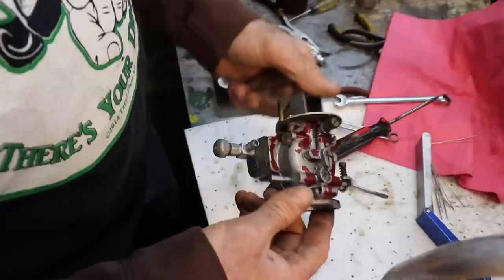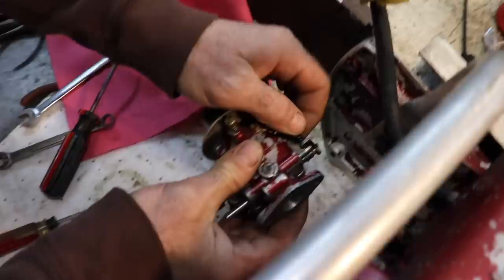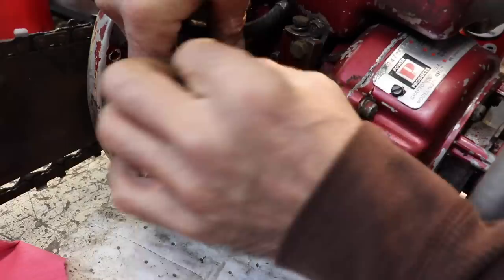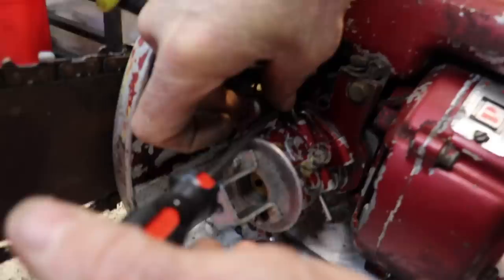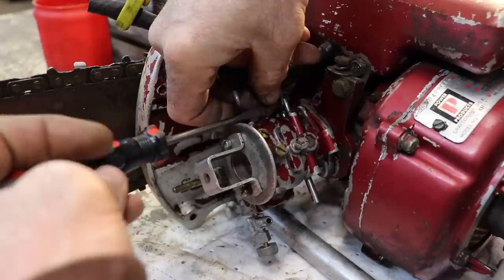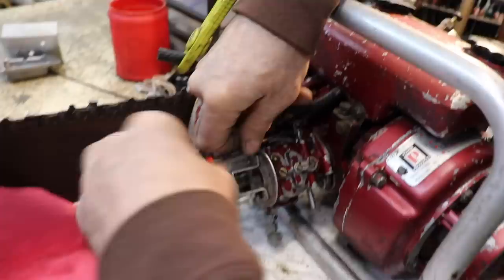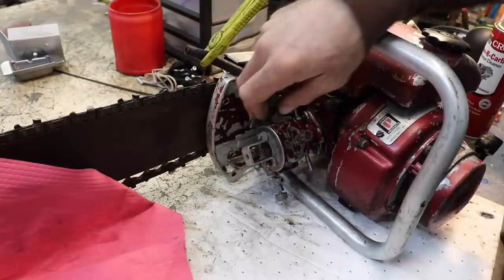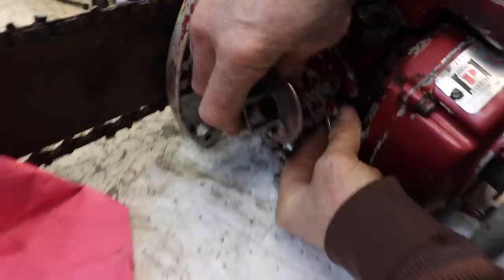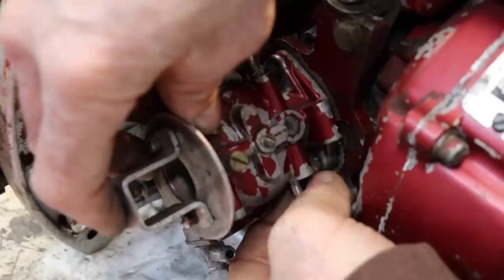Okay, now let's put it back on the chainsaw. Take out this idle screw. Put it over the studs, and put our idle screw back in. Don't give me much room in here. Now with octopus fingers, tentacle-like fingers, to get these nuts started. And we'll tighten it down.